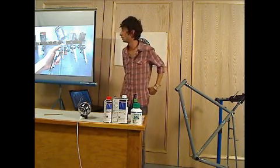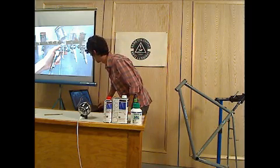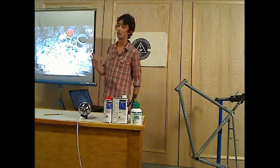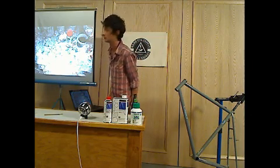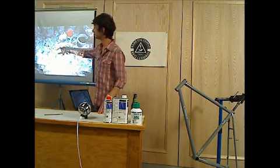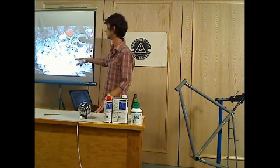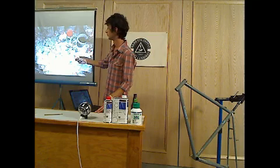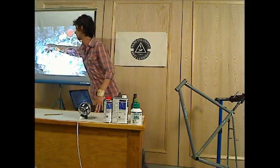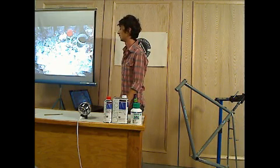There's all different kinds though. So I like these. These are the only ones I've used. But yeah, so those are the guns. You can kind of see a little dissection here if you were to take it apart, which might probably fall everywhere. But here's kind of what happens. You've got the needle in here, which when you're pulling the trigger, it just kind of releases backwards. And then you've got a spring and the air control, right, the liquid control right here. And then the nozzle, and then you've got the nozzle cap and the cup. So that's pretty much the anatomy of that gun.